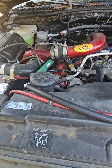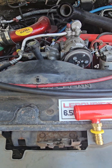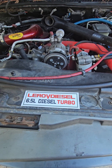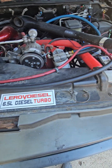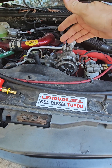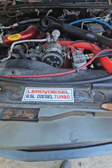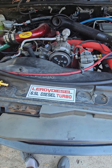It's just another thing in the chain of events. On these 6.5s they're so lacking for cooling that they constantly run hot. You may still run hot even after all these mods — the high performance radiator, balanced flow water pump, clutch fan blade, bypass restrictor, and now this component. But if you're pulling hard with these trucks, I've never been able to figure it out — nobody has even been able to explain it to me.